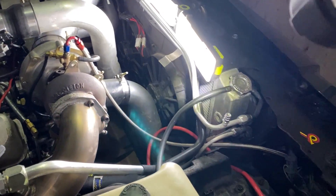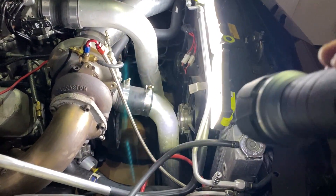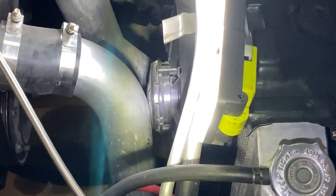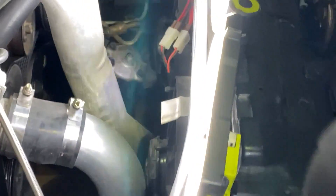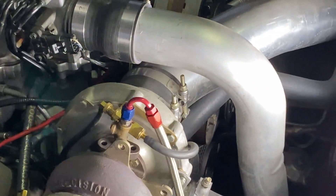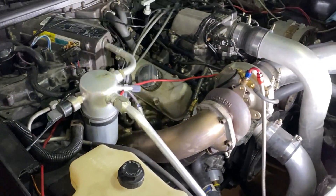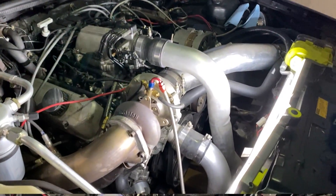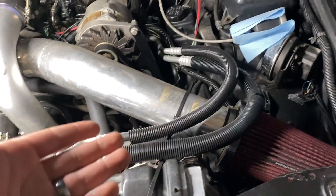Among the other things I have to fix on this car: the fans are pressing against the radiator core very hard, actually bending the fins, and I don't want them to wear through. Also, that pipe is hitting that fan — I may have to clearance the pipe like I did on the '87. I'm trying to keep this one drivable and not have it down for a long time, which is why I haven't done any of the charge pipes or powder coating yet — that'll take at least four weeks from drop-off to reinstall.